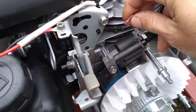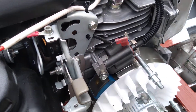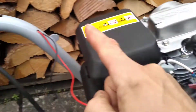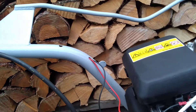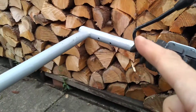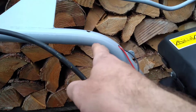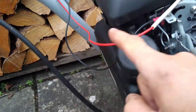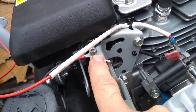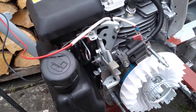I've just run an additional wire here, so that wire then goes to the switch at the end — it threads through here — and then all I need to do is at the switch just short that to ground. I could have shorted it to the framework, but to be on the absolutely safe side I've run a return wire back from that switch, which I've screwed down onto a known good ground point, because I wasn't 100% satisfied that I'd have good earth bonding between the engine and the chassis.